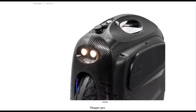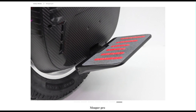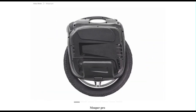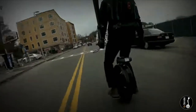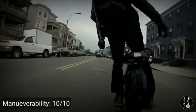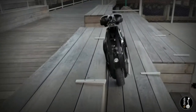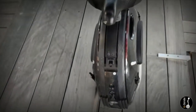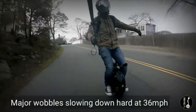The form factor of the MSX PRO won't change much — apart from what we can see on Gotway's website, there doesn't seem to be many changes other than the lift switch and the double T6 headlights. This is very good news, because in my initial impression of the Nikola Plus, I stated that wheel is unmatched in speed and acceleration, but the major drawback was how thick, tall, and heavy it was — a combination that wasn't ideal for maneuvering in heavy traffic or around obstacles at high speeds. Hard braking at 35 to 38 mph on the Nikola Plus can also cause major wobbles, resulting in a crash.